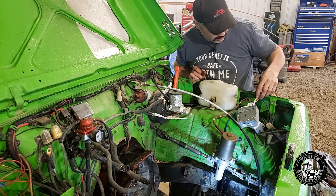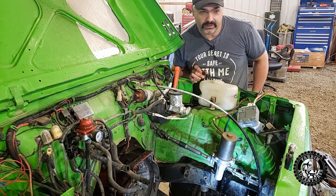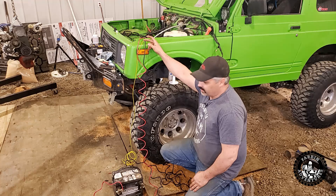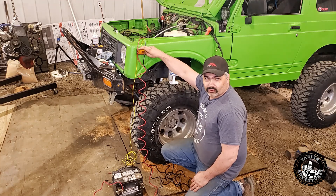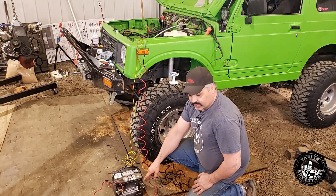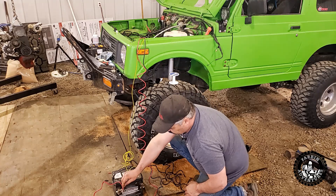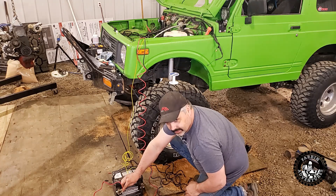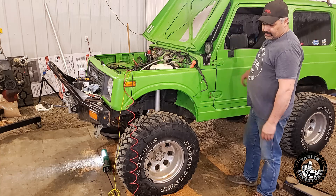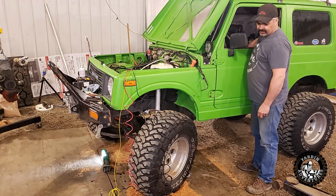I've temporarily wired it down to a battery to test her out — kind of got it hillbilly wired up. Black and red wire coming over the top, and the yellow ignition-triggered wire coming over the top. Red wire goes to positive on the battery, black wire goes to negative, and all I have to do to activate it is touch the yellow to the positive and you'll hear it click. The ECM should be live — and now that it's live, I should be able to just reach in and turn it lock to lock. Look at that — man, that's going to be awesome.